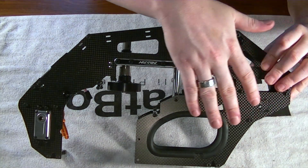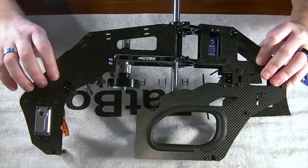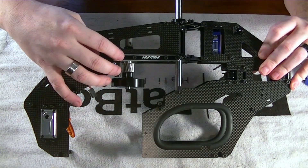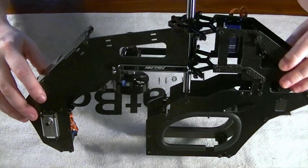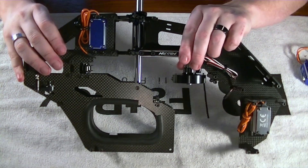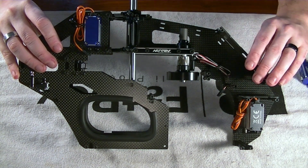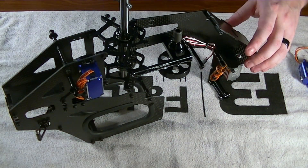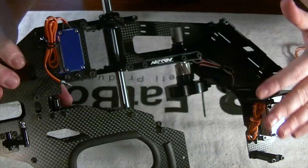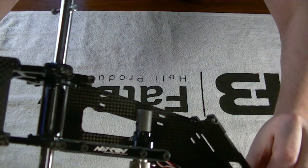Up until this point in the build, every bolt on this side — besides these two adjustable ones, which will probably be for the fan shroud — everything on this side of the frame is completely Loctited. I don't see any reason I'm going to have to remove anything. Also, besides the clutch stack, that's not Loctited because we might have to shift that forward or backwards. On this back end, everything is completely Loctited, and I have not yet united the frames together with this side. I put all my extra screws where they go on the opposing side so when I go to put the missing parts in, I just remove those screws, put the part on, and put my screws on.